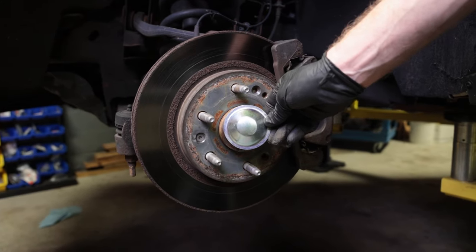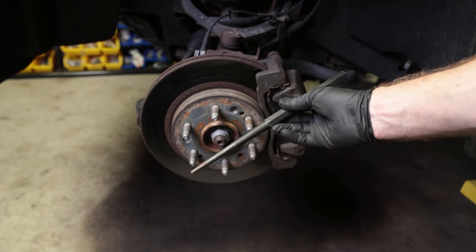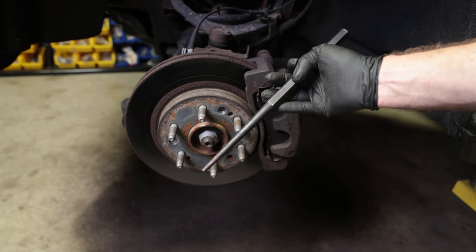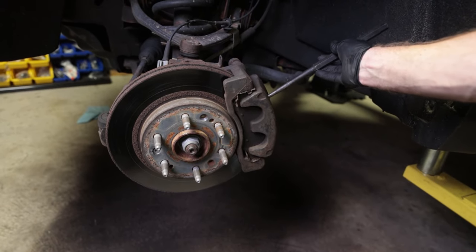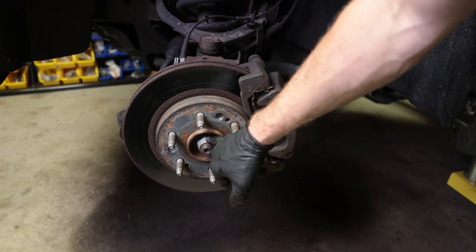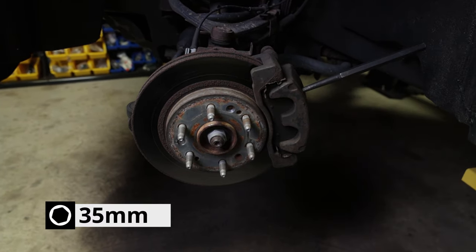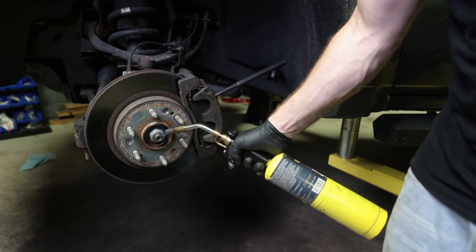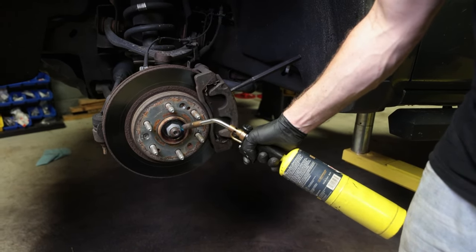As I mentioned earlier, my truck currently does not have a cap, but we will be adding one on after. Following the official instructions, you're going to take a drift pin — we'll have one linked in the description along with all the parts and tools used in this video. You're going to stick the drift pin through your caliper and lock it into the rotor, which will hold your axle in place while you remove the nut. It is a 35-millimeter nut. We're going to heat it up a little bit with a torch to make our lives a little bit easier — on the other side I didn't do this and it came right off with an impact, but it never hurts to add a little heat. Whenever using heat, just make sure you're not heating up anything that could be damaged.